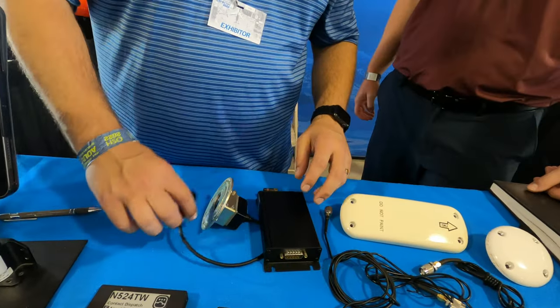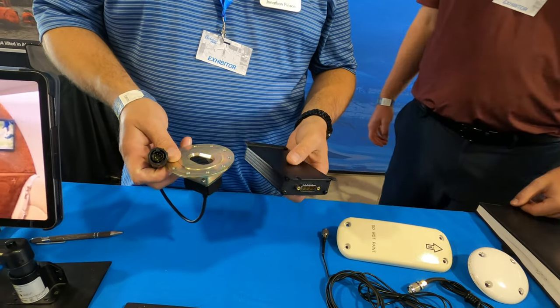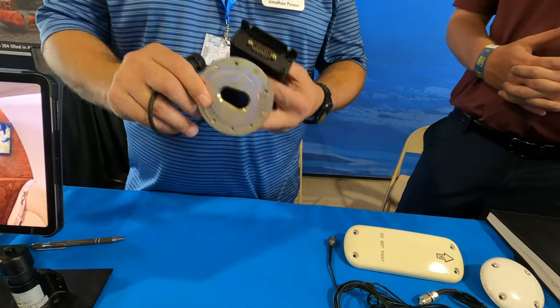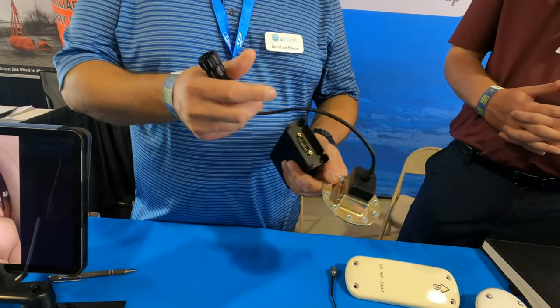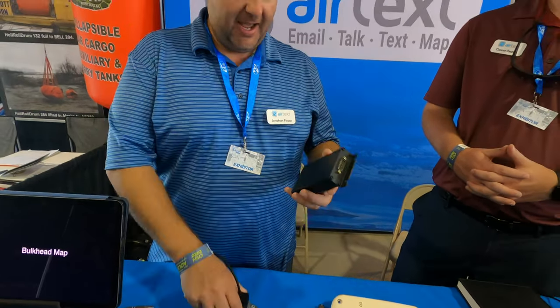Thank you, sir. This is a pretty cool product for the RV-10. It's essentially an altitude call-out device. You stick this in one of the two inspection panels under the wing, and it has a LiDAR sensor that takes measurements 100 times a second. And you'd wire it up to your audio panel, and it would do call-outs all the way from starting at 500 feet, 400, 300, 200, all the way down to 1 foot.